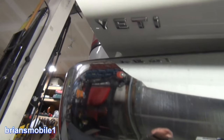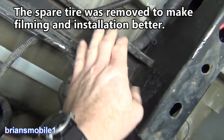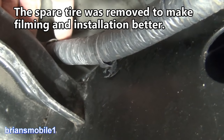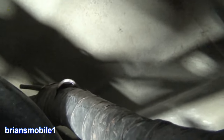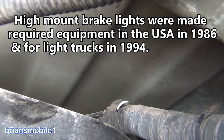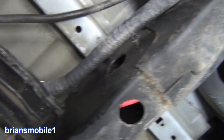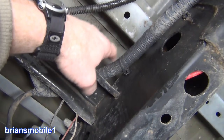The ground wire you can ground to anything on the vehicle, but the power wire is located underneath the truck. Follow the bumper back — here's your trailer hitch going to the frame, and then there's this bar here. You don't have to cut or get into anything really. It's just taped up on top here. The wire is right there — it's white and purple. This one's all taped up. It's actually outside the loom, just taped over the top, so you don't see it unless you're looking for it. Come up over the top and you see it's white with a purple wire. I know this is the same for 2013. For 2016, another guy had a video where he was pulling the wire out further up, so that's a possibility. But most of the time it's going to be just up here close — you just run it up through the tail lights.